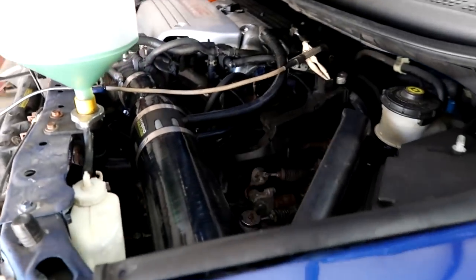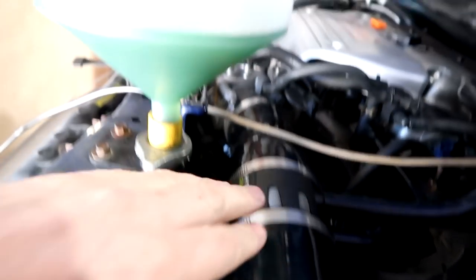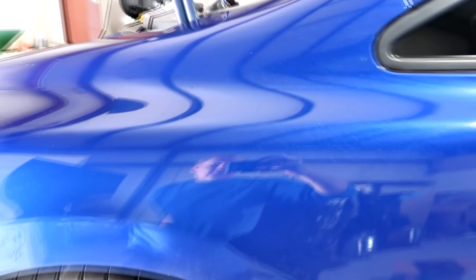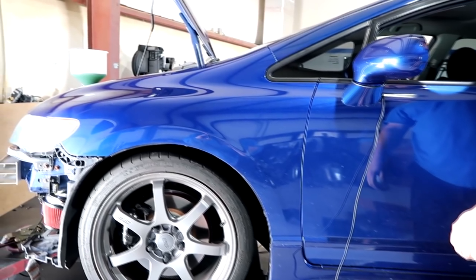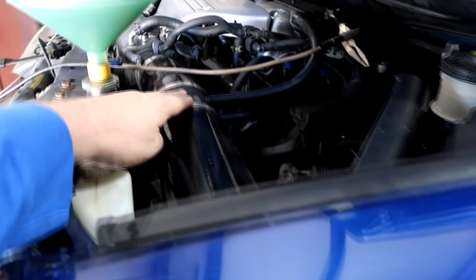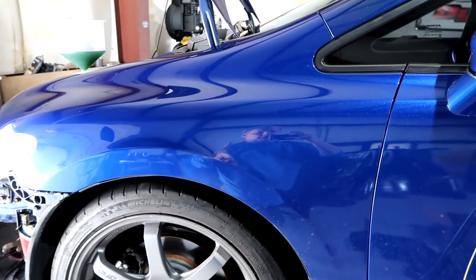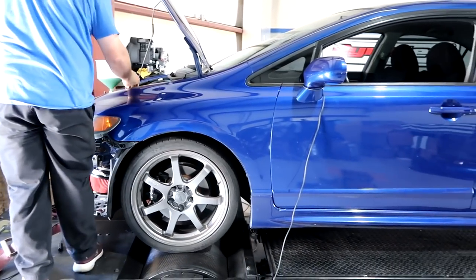They do give you an adapter piece that replaces the throttle body connection if you go with the ZDX throttle body. This piece is supposed to prevent hydrolock — if the intake gets submerged, this foam has access to the back side of the plastic so it can suck air from there. Think of it like a McDonald's straw with a little hole in the side — you can't pull the fluid up because the air comes through. It's a pretty good system. It's a direct bolt-on with a little bit of tweaking and extra labor. The map I put in is speed density, so it's not running off the mass sensor — the car isn't going to run with a factory calibration with this different diameter intake.